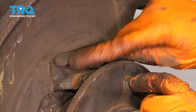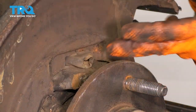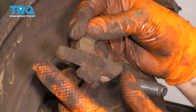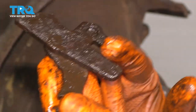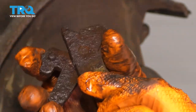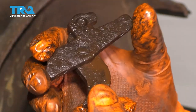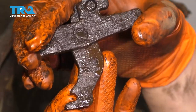One last thing I want to remove and lubricate because it's kind of frozen up is this parking brake lever. I'm going to pull it to the side and out, push this boot back, and take it over to my workbench to soak in some rust penetrant — because these two pieces actually need to pivot on each other. Otherwise your parking brake will not operate. I soaked it in penetrating fluid and lightly tapped it back and forth in a vise. It really did not take much to loosen it up. This does actually come apart into two pieces — just wiggle it and they should separate. Remember which direction it goes; it's important, otherwise it won't fit or operate properly. I'm going to take it to my wire wheel and clean up all the rust on it.